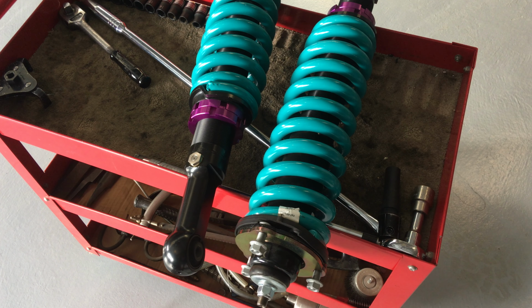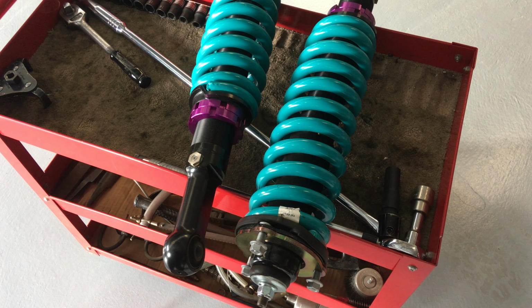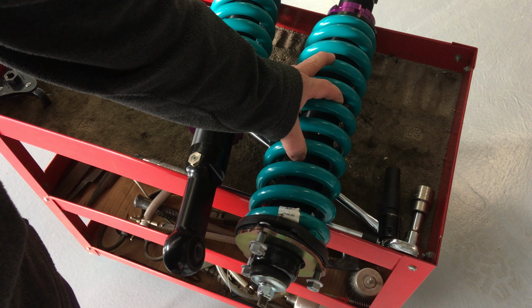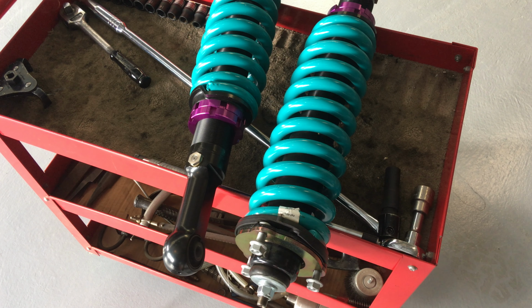What it is, you've added more weight. It hasn't sagged. It's been lowered. You've added weight, so the vehicle hasn't really sagged. Wrong word, okay? So be careful where you call it sag. Please say the vehicle's too low now because I've added weight. Of course it settles from what it is on day dot. A couple of weeks later, it might be 10 mil lower, depending. It's going to settle twice as much at the front as the rear for the reasons we explained, the double thing, because of the spring, right?